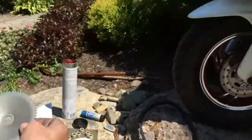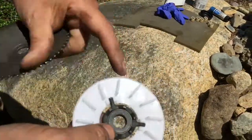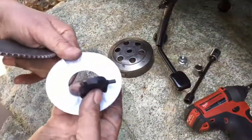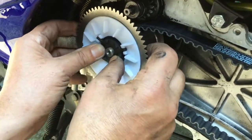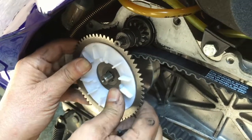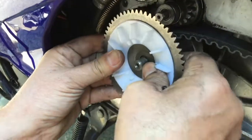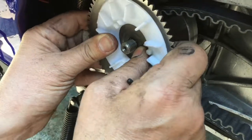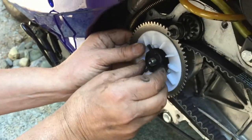Next, I'm going to take my new drive plate. This is the variator drive face, and your Bendix actually hits this — your starting Bendix — and starts your bike. They have splines on it. So I'm going to put this on. The front goes like this, and these little pieces go in here. I'm going to make sure I've got all my teeth on there and get these teeth lined up.